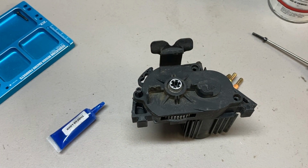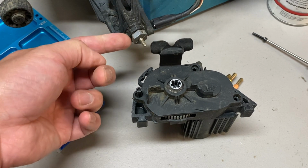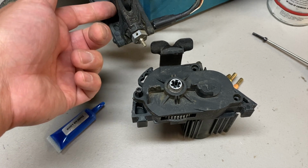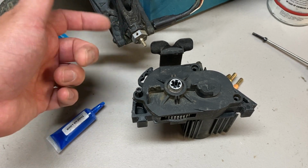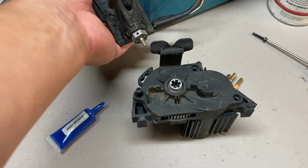So definitely something you want to check out of the box. I think these 3S lines maybe aren't put together the best. Also had one of my axle screws pull out. So the back rear one is going to be the one that tends to unthread by itself. So I don't think there was any Loctite on that. So you want to take that drive shaft, remove it, and then thread lock it into the axle. That's another common problem on these.